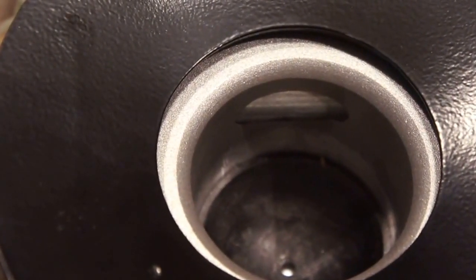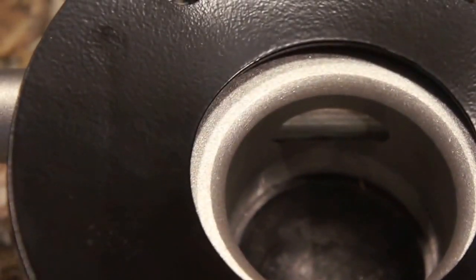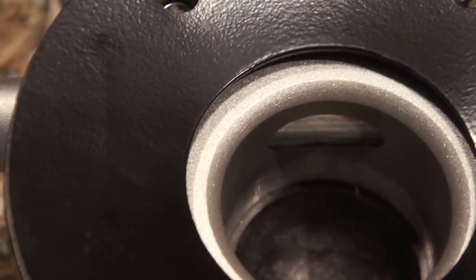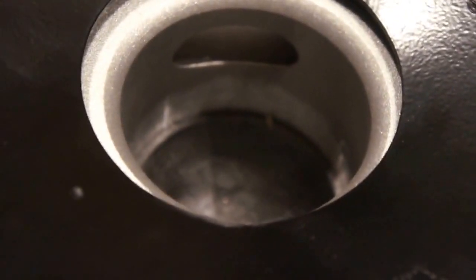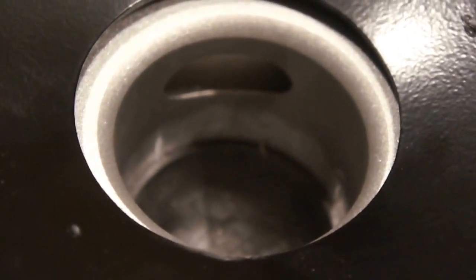And at about the 12 o'clock position, you can see a kind of a bar coming across. Well, that's what the locking lever does. So right now it's in the locked position. The ball would be there. I'm going to try to, for the video, pull it out. There you go. So this would be in the unlock or the out position. So in this position, you would drop down onto the ball, and then when you're there, you would twist, turn, push, lock. And now it would lock onto the ball.